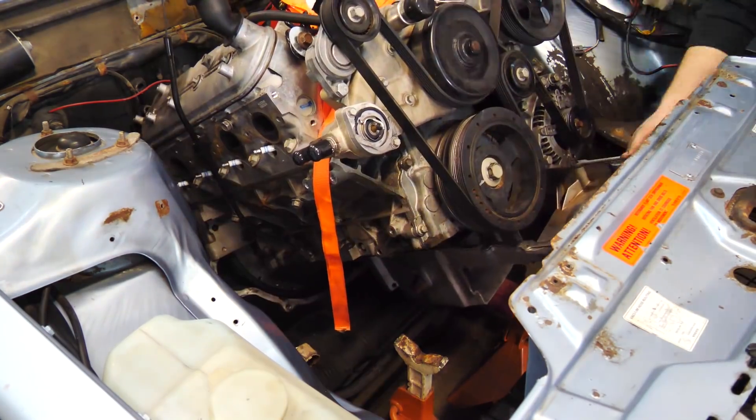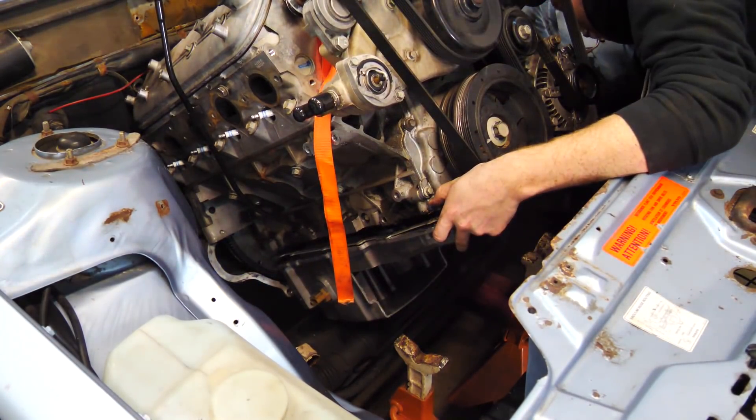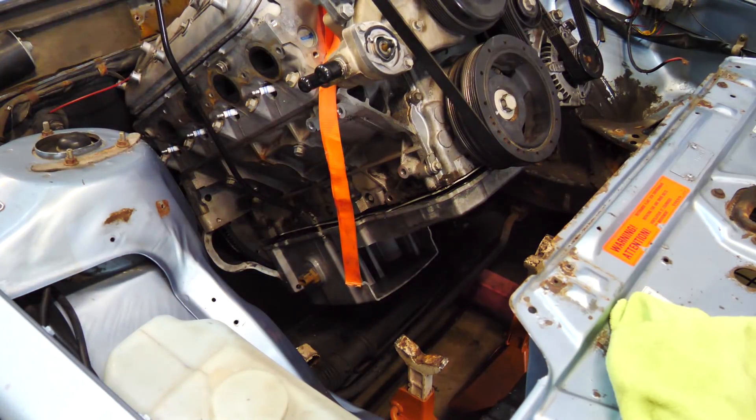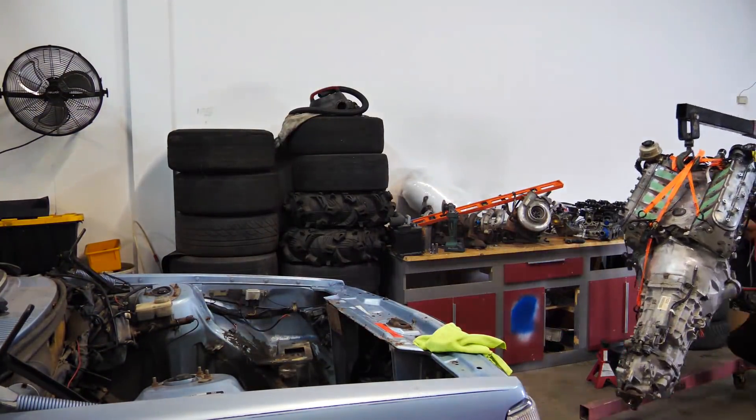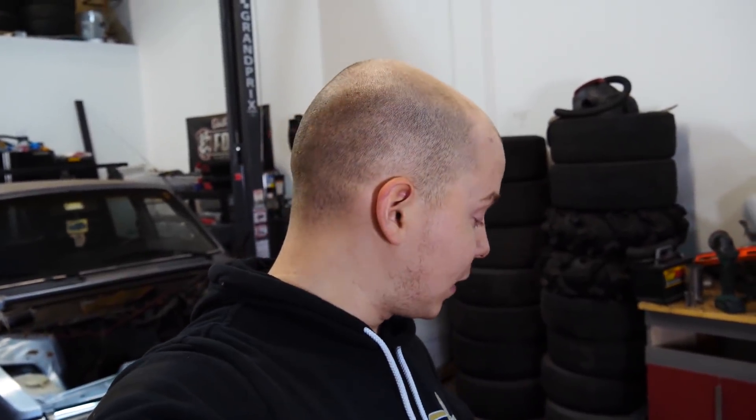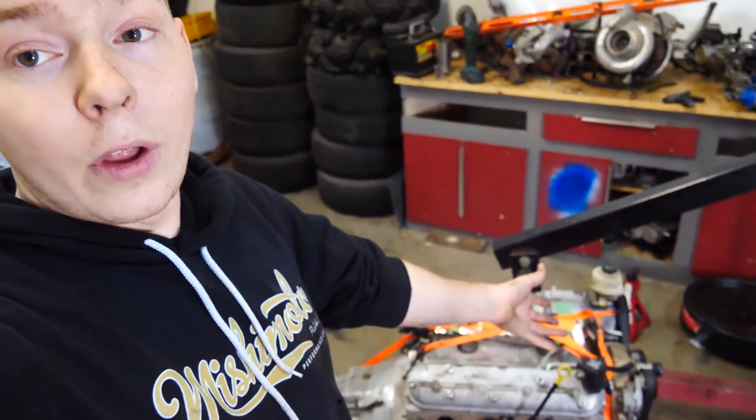It's impossible to get this thing on. So I definitely underestimated the size of this engine. I was expecting to be able to put it in and be done, but unfortunately we're going to have a little bit more work on our hands. The problem is that it is physically impossible to get the oil pan on the engine if the engine and the trans aren't together in the car. So what I have to do is put the engine in, put the oil pan on, then put the trans on. The other problem is that I can't really put the trans on the engine unless the engine is mounted — imagine trying to put a pretty heavy trans on an engine that's floating around on a hoist while on your back under a car. It's not going to work. So let's get ready to build some mounts.